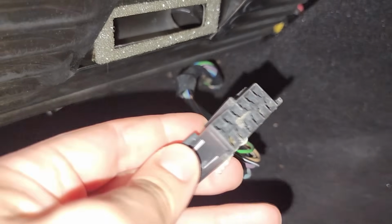When you hear absolutely nothing, like we just did trying to crank a car over, it's classified as a no crank, no start. And if this were a modern car, we could hook up a diagnostic code reader to it, and it would generally throw a code as to why the car didn't start and lead you right to the problem. This is not a modern car, so it does not have an OBD2 port. It does have an OBD1 port, something I've never used before.